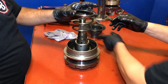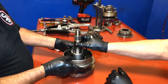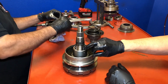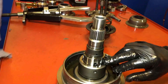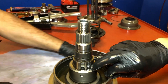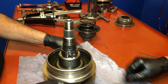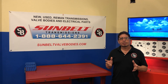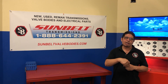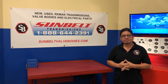Let's put that out there. We've got our spring — 400 pounds. And I want to show you this guide right here — here's where the ball bearings would be on this unit. This is really important because after a while the ball bearings go square and the variator will start jumping because it needs to have the bearings replaced. This is Fabian again — I hope you liked our video. Please don't forget to subscribe, because the more you subscribe, the more videos I'll make. Thank you and have a great day.